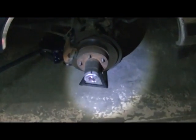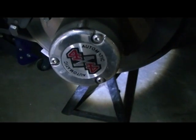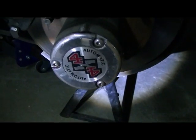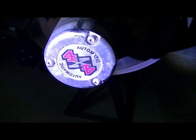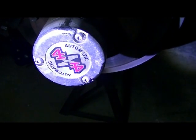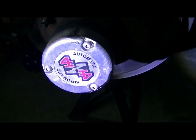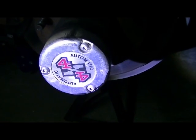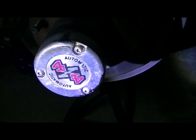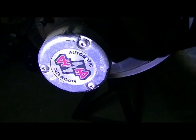Okay, I'm back. Got the wheel off. Now we're going to take a look at exploring changing out these hubs. I have the 3-hole cap. Apparently when you go online and start looking up your manual hubs, there's a difference between, I believe, the 5-screw and the 3-screw. For the 3-screw, they say you need the nut conversion kit, for the bearing, the lock nut and the adjusting nut. I already did the other side, so I can tell you with 100% certainty that you do need that.